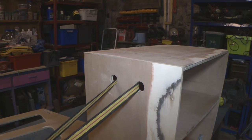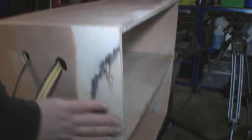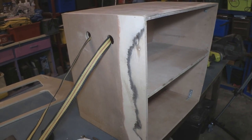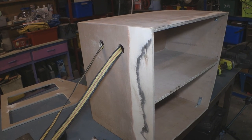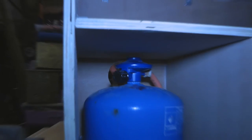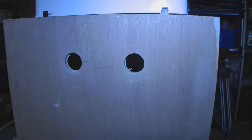So that's the plan - I'll go for that on both boxes. There's a mark here where I sanded it down to get this edge to fit the front of the box, because I messed up on my cutting of the front panel slightly and I couldn't be bothered cutting a new one. This is all getting covered anyway so it's not a big deal. If I were to build another cupboard set like these, I'd use the lessons I've learned to get it perfect. That feels like a good point to stop today - I think I've got most of the holes drilled. You can see where the hob will sit and the gas bottle's sitting in there. You can see at the back the hole where the regulator can come through no bother. I've got the holes for the seatbelt and the holes for the cam straps that go underneath the seats in front.